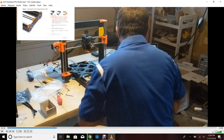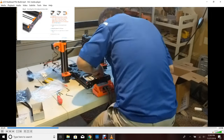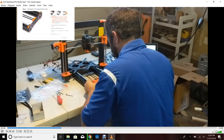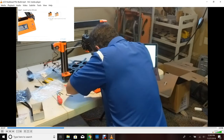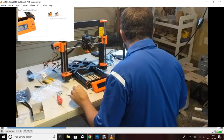One thing to note: I didn't have the stands put on from the very beginning — I waited to do it later. I found that when I was building earlier, those stands would come apart and get in the way. But now is the time to do it, because otherwise the LCD will sit on the table and it will torque up or bend, and you don't want it to snap off. So put those on before you put the LCD unit onto the printer. Then once that's on, the last step is just putting the knob onto the LCD assembly — it fits right on, no problems. Really easy, didn't take long at all.